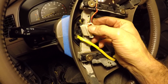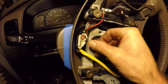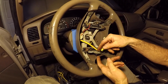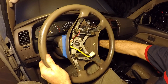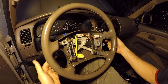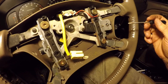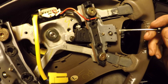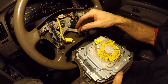Now we plug in the power clip for the cruise control. We'll unlock the steering wheel so it's easier to get at the torx bolts — I'll put the key in the ignition and unlock it, then turn it straight. Now we can get at the torx bolts more easily. If you haven't already, take the little plastic round hatches off so you can get at the torx bolts.